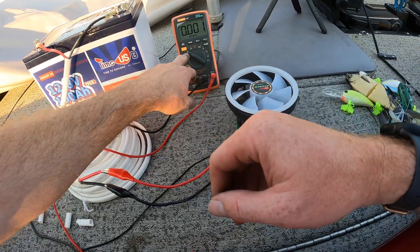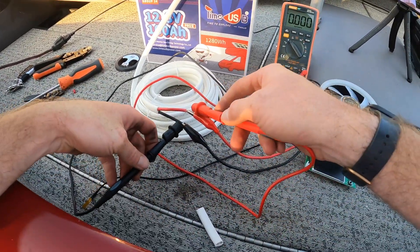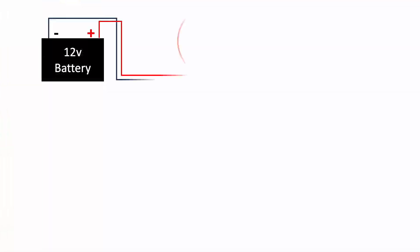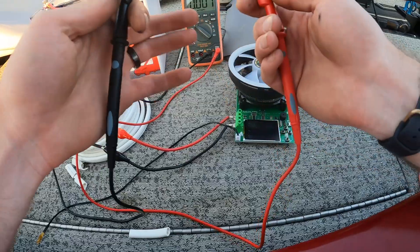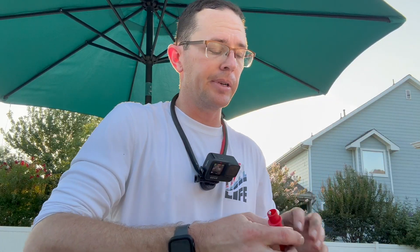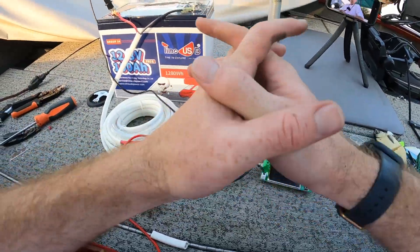The way we set up our multimeter is like this — we've got it on volts DC. You can see down here, this is going to the battery and it's going to read 13 volts, but that's not what we're going to do. What you want to do is measure the voltage drop along the length of the wire. We're going to go positive to positive along the wire. You can check it on both ends with both leads, positive and negative, but then you have to do math and there's going to be some variance. So we're going to take our negative lead and put it on the positive cable, and then take our positive lead and put it as far as we can in our circuit.